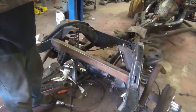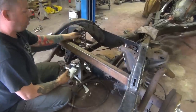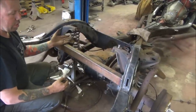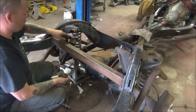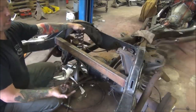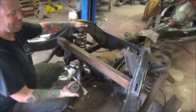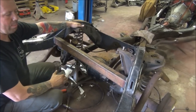With hydraulics, once you put on a hydraulic suspension, it makes certain things on the car no longer relevant. As you can see, these are the shock mounts. My car had air shocks in the rear — they allowed me to raise or lower the rear of the car about three inches. But since we're going to have hydraulic cylinders, these are no longer relevant. So we're going to remove these cylinders and the airlines that go with them. The mounts associated with these cylinders are no longer necessary either, so instead of keeping them on and potentially having something in the way, we're going to go ahead and cut these mounts completely off, grind it smooth, and put some primer on it so it doesn't rust in the bare metal areas. This is not required — they could stay on there. The shocks themselves will not stay, but if you wanted to leave the mounts, you could. It's a personal choice to cut them away.